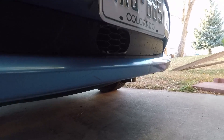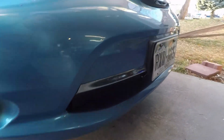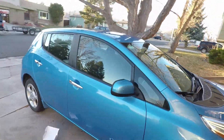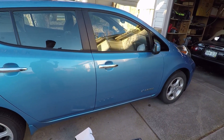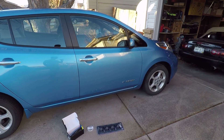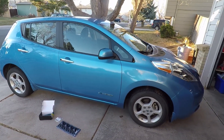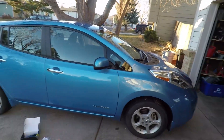That little hole I found is optimum for winter temperatures — which it is winter time right now even though it's 65 degrees out and I'm wearing short sleeves. So right now I'm going to do stage two of aero mods to my LEAF in the hopes of gaining a little bit more efficiency. When I did these reverse guards and the front air dam, I increased 0.2 miles per kilowatt hour over the stock configuration, and I was able to test that by driving back-to-back on a relatively flat road and then taking off the mods and going again.